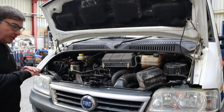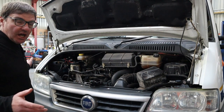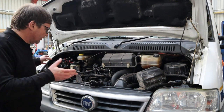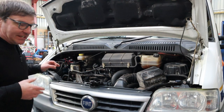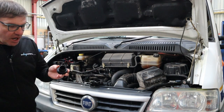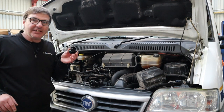Coming to the engine side, you need to do a general check — just make sure there's no bad corrosion. You might get a little bit because of the age of the vehicle, but make sure it's not too bad. Do a general check of all your levels, making sure there's antifreeze in the water. Then the main one is your oil cap — if you take it off and find any white sludge on it, that's the sign of a head gasket going.